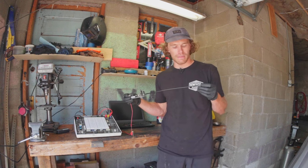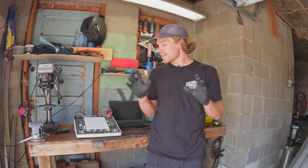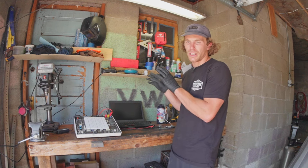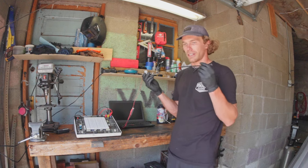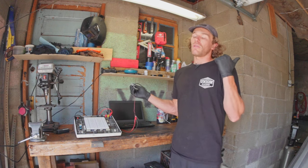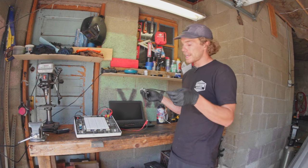Professor Dave was here earlier but he's no longer here. At any rate, he came in and there are kind of two parts to my VNT control system. We're using an Arduino-based code and controller powering a 12-volt linear actuator to control my Sprinter van VNT turbo, which is on my 1984 1.6-liter turbodiesel.